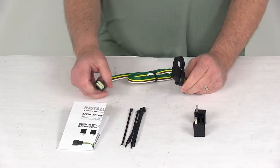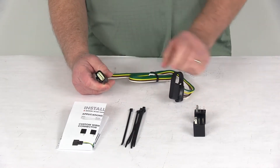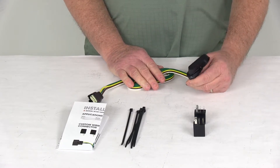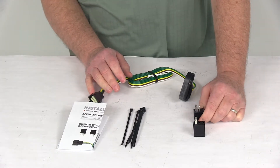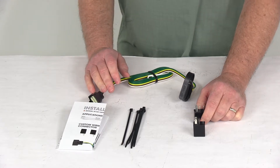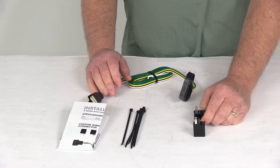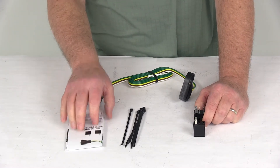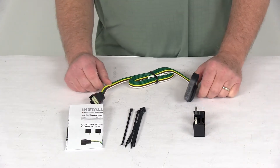To install, locate the connection point behind the rear tire along the frame rail and plug in the key connector. Route the four-way out to the center of the vehicle and out of the trunk. For the two relays, open the trunk and locate the storage compartment on the driver's side of the cargo area — there you'll find the fuse panel. Insert the two provided relays in the location shown in the instructions. Once they're installed, your system is all ready to go.